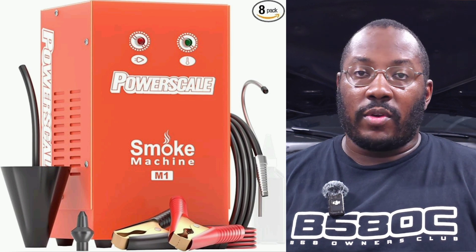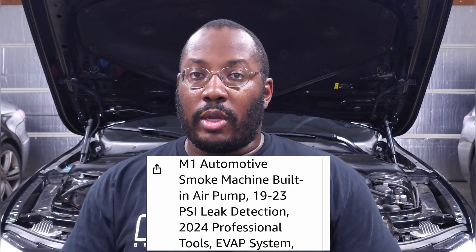We have tools to fix this. This is a kit I found on Amazon. I like it for a couple of reasons — it actually pressurizes the system, which is the main thing you need to do to check for boost leaks. You hook it up to your intake, pressurize the system, and find areas where air is leaking out. It has a built-in compressor, so you don't need an external compressor. Most options on Amazon are limited to around 14–15 psi, but this one is capable of over 20 psi. The rule of thumb is to test at whatever boost pressure you're running.